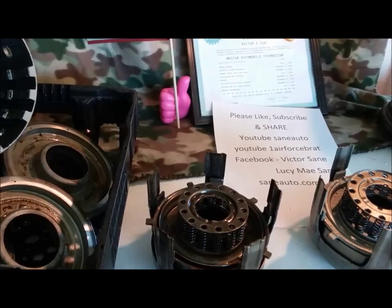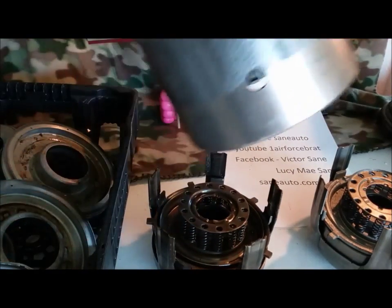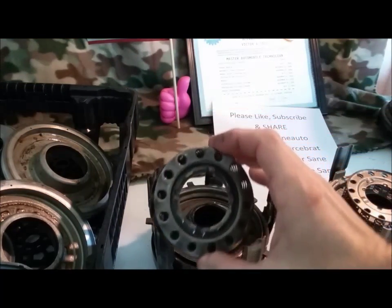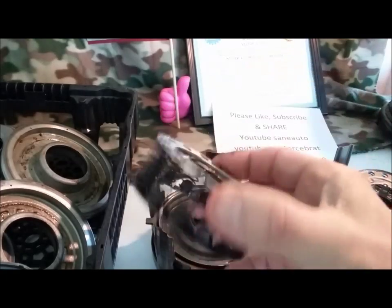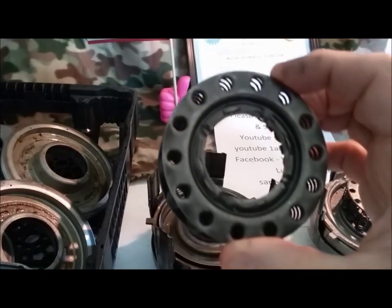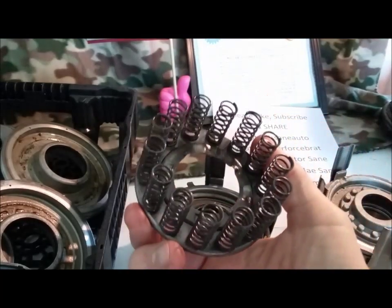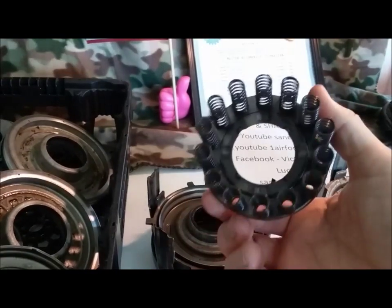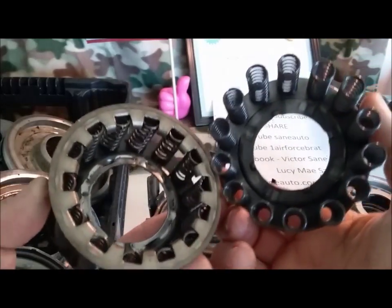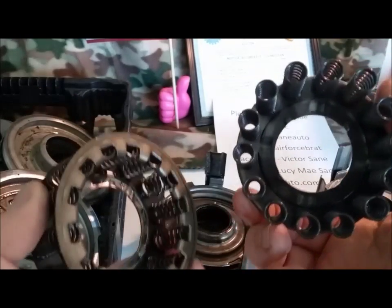I think this input drum came by and puked pistons all over my table. So let's see what these pistons are. First, we have the retainer for the 4L60E. There's going to be some bonus material here above and below, beyond the pistons. This retainer — 4L60E — see how different it is? 700R4 and early 4L60E. Bottom, top — very different. Very easy to tell the difference.